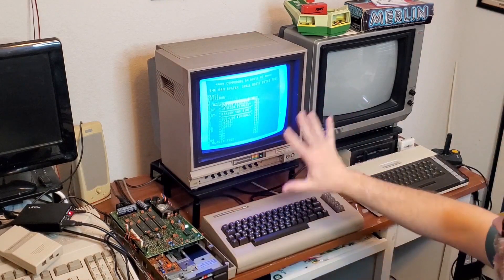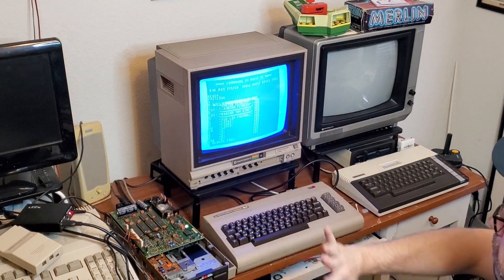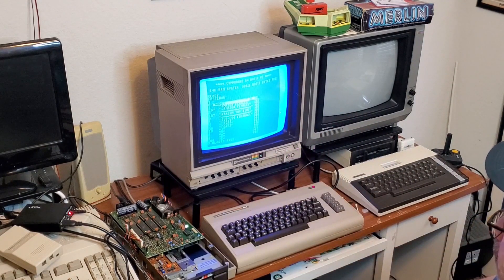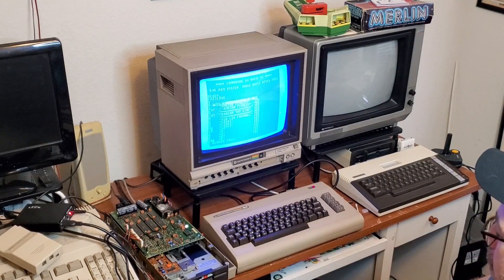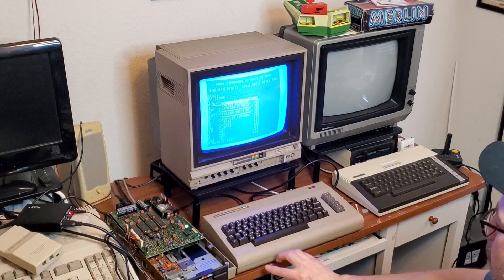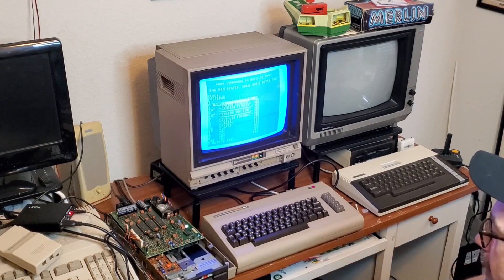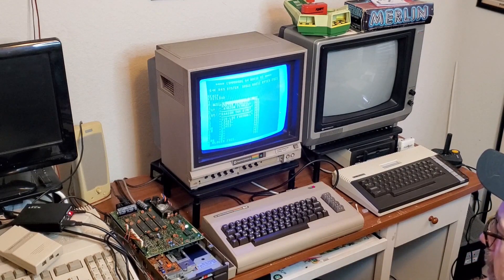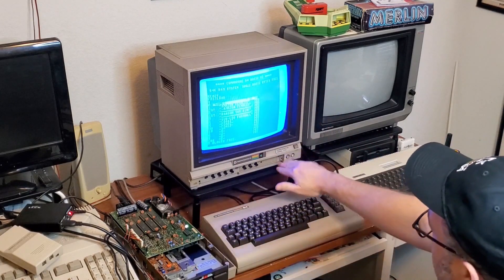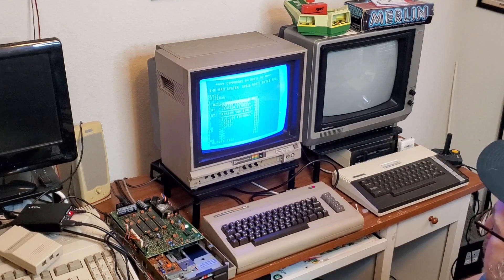All the hardware pieces I got in this pickup work perfectly for the age — besides the keyboard issue, but that's an easy fix. I have extra keyboard tops from other Commodores anyway. Everything chip-wise is working and I'm happy with that — nothing I have to fix there. We'll clean up the keyboard. The drive just had a dirty head. I still need to get the door for the monitor and replace it, but the screen looks good, sound plays just fine. The 1701 is working.